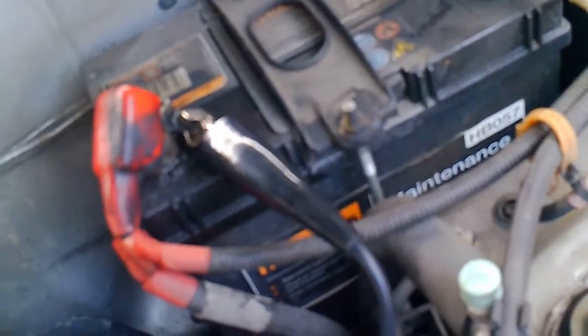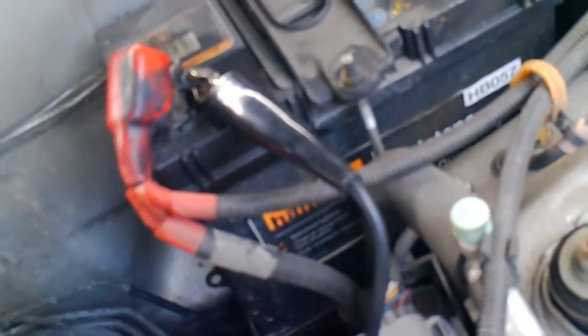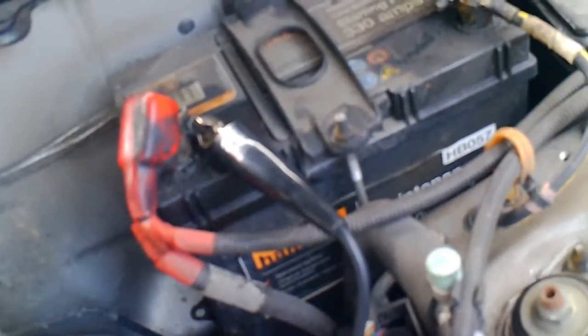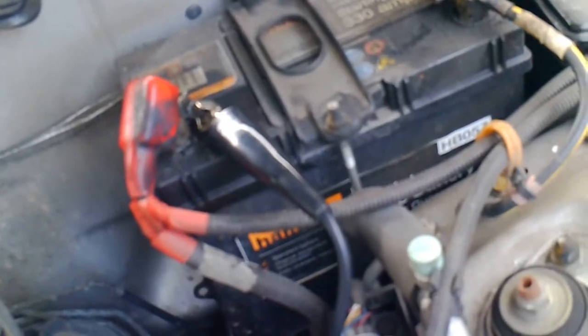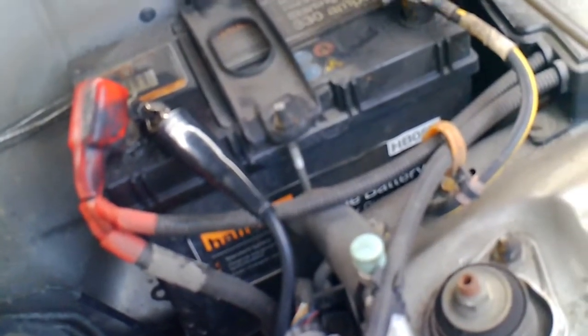We need to keep all our earth points clean. We're connected to battery positive looking for all the engine earths, any earths on the car, whether it be lights, headlights, various places like that. Always consult a Haynes manual or anything official before undertaking any sort of electrical work.